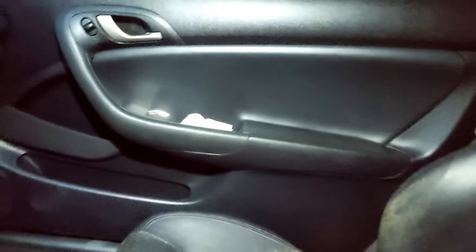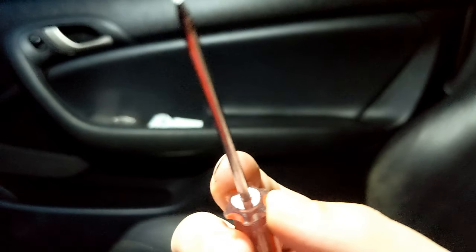And the last light — this one right here. This is the bane of my existence when it comes to the interior light. Because of this — that pure blue LED. I mean, if that's your taste, sure, I guess. But nope, not mine. Should be pretty simple. You just take your tool or whatever and wedge it between the gray plastic housing and the clear plastic. I took it out — it took a little bit of work. It'll definitely be an easier job doing all these if you have a tool or flat head that was pretty thin at the tip, because the space between the clear and gray plastic housing was tiny.